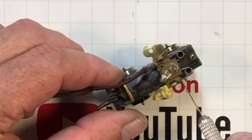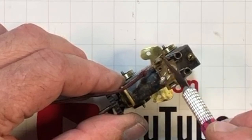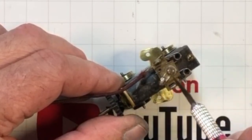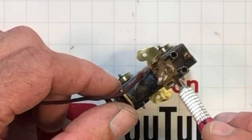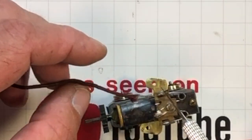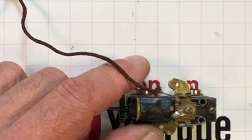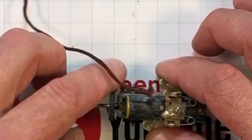Make sure when you're cleaning these up that you clean these springs off of any rust, because the juice starts up here and it's got to flow through the spring. So make sure to clean those. Now I want to hear what this thing sounds like.